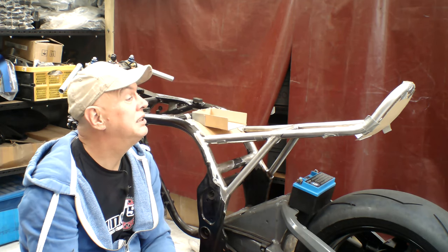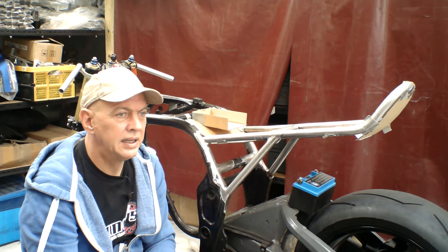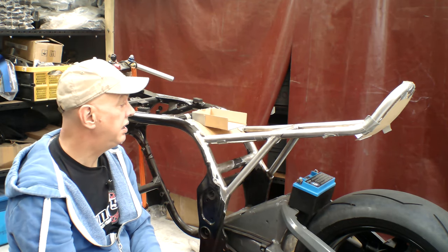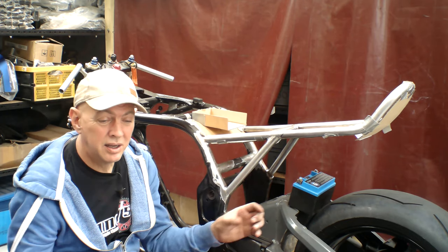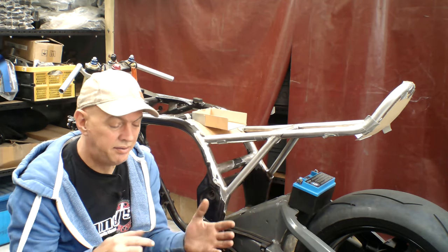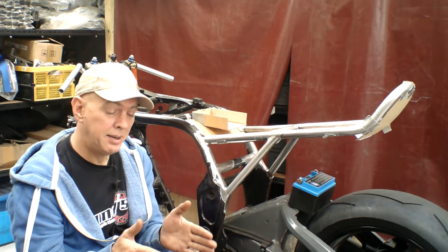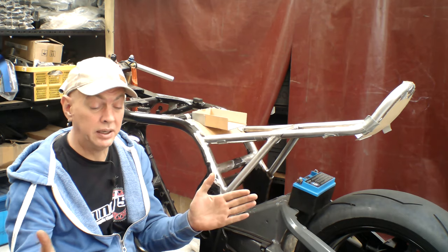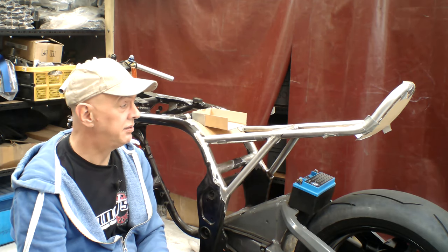So the thing that I'm going to be making to do that is a box pan brake. I've already got the steel on the way down, so when it gets here, I'll go through and make one of them, because it's just a handy thing to have. Any boxes that I want to bend out, I can put a nice bend in it, and it's not like a sheet metal brake, which is one solid thing, because it's hard doing corners. If you want to do all four corners on a box, you can't really do it with one of them. A box pan brake is the same sort of thing, but it's got adjustable blades on it which you can move apart, so you can decide how big or how small you want the folding blade to be, and it just makes this sort of stuff a lot easier.